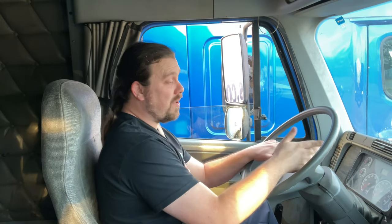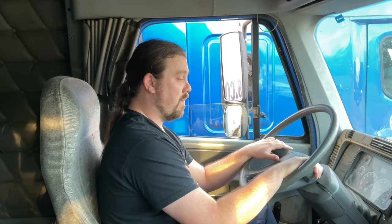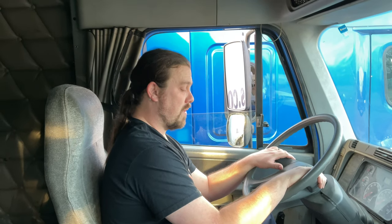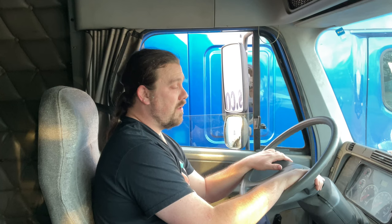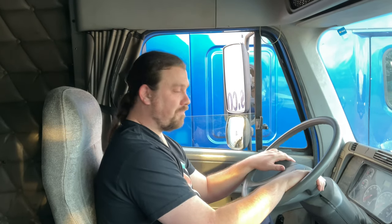No leaks. Now I'm going to look at my gauges. I should be losing no more than 3 PSI in 1 minute. Continue. Okay. Now I'm going to apply the brake pressure, and I should be losing no more than 4 PSI in a minute. Continue. Okay. And I didn't.